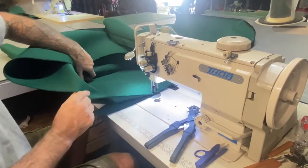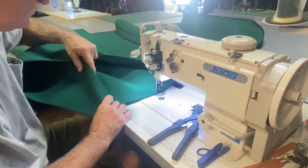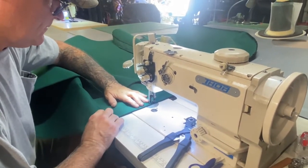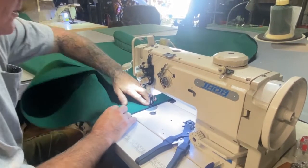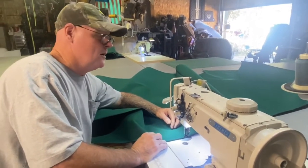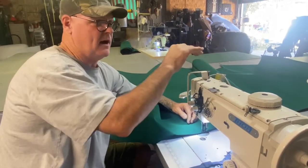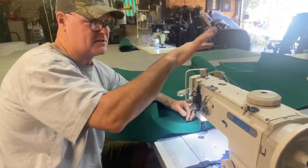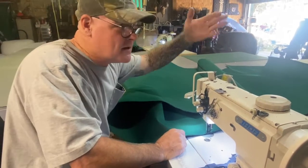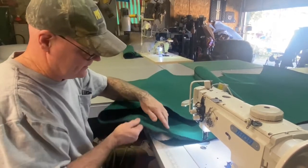But, you know, most all these boats it's pretty straightforward patterns. Just make sure, before you start, to be mindful of how the boat top sets on the boat. Put it on the boat and look at it. How much sag is in the middle? How much wiggle room do you have? How much is on the front? Just because it sags in the middle doesn't mean you have just as much forgiveness in the front. That's incorrect. That's a common mistake that people make.